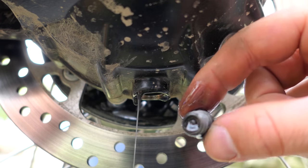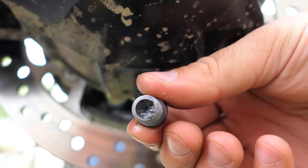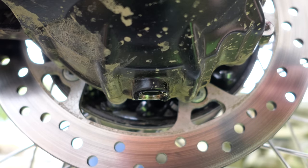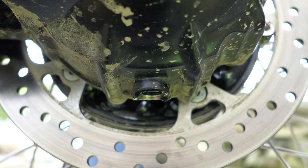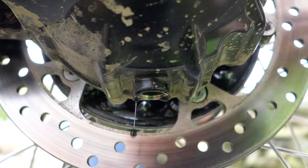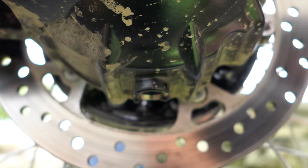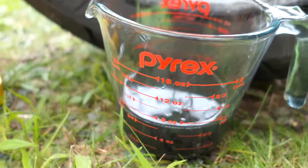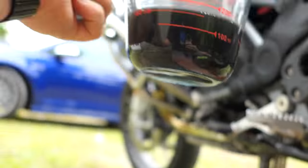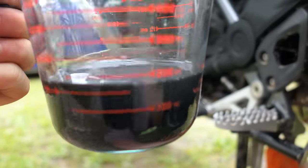While it's fully draining, take your drain plug and use a microfiber towel and clean out some of the gunk. There is going to be gunk in there, so get that clean. I'm actually going to use a couple of screwdrivers here to get this stuff out. This guy is now completely clean — you can see inside, looks good. Now if you look at this stuff, this gunk that we have, it is nasty. As promised, we do have just under 200 milliliters. But look at how nasty that is — gross.